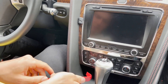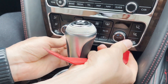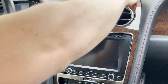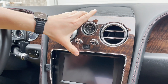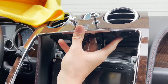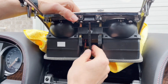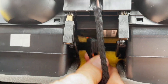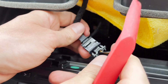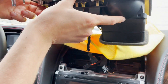We're first going to take our panel removal tool and get underneath here, then use our fingers, and also try the top to remove this panel. At this point you can take your microfiber cloth and put it in the back here so the corners don't scratch the car. There are two connections here which we have to undo — there's one right here, press the clip at the back. Then there's a clip underneath which you have to move and release, and then press on both sides. At this point we can take this panel and move it away.